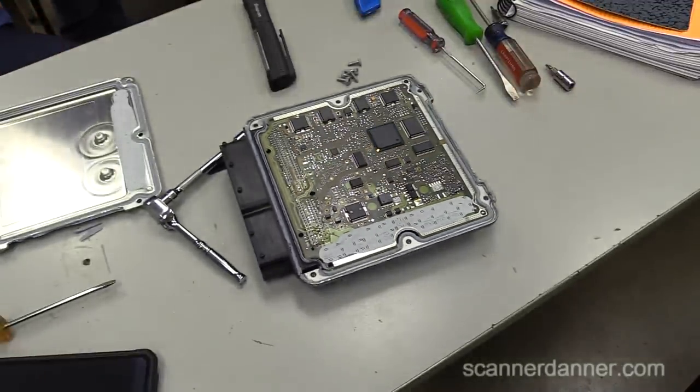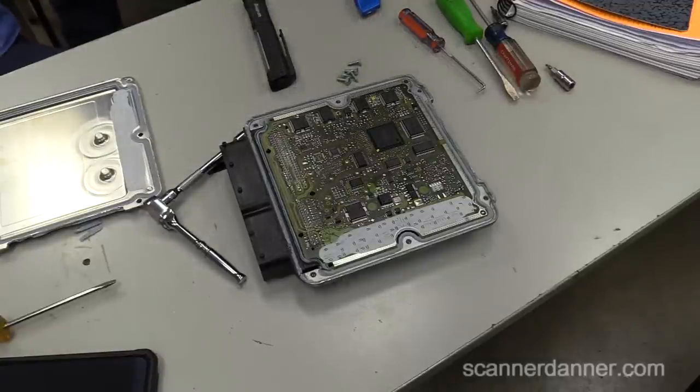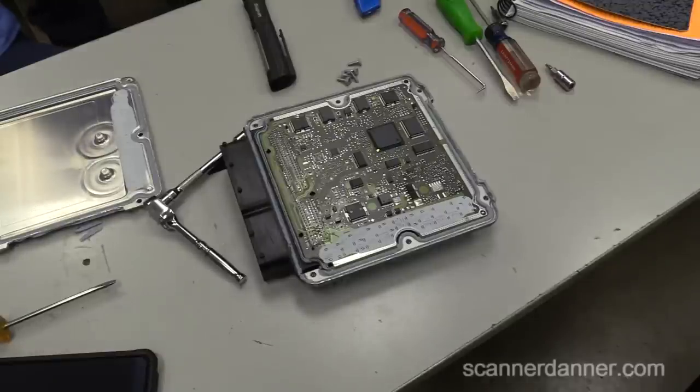Here's the other thing: it's a good thing we did the timing belt check because even if you put this together, this car's not going to run. And I think that would explain why we were able to get our cam sensor signal back but our coil firings were still the same - because we have a garbage signal. Garbage in, garbage out. Cam and crank are not aligned. The computer doesn't know what to do with these coils.